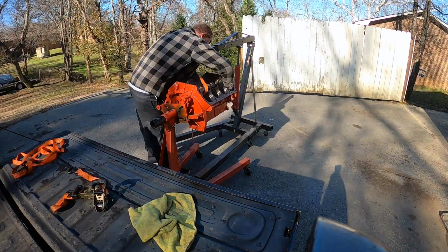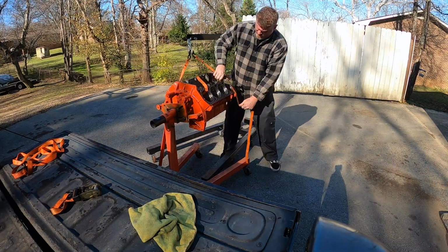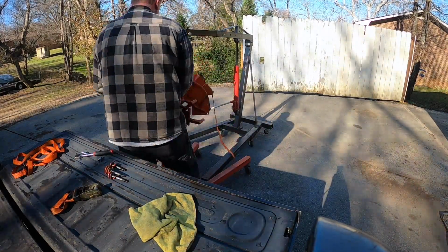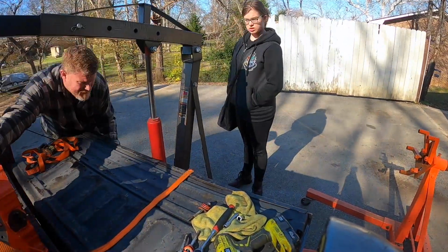Tommy's is going to go check it out. They're going to put their gauges on it and make sure that everything's running smooth. You definitely don't want a tight camshaft. That's a quick way to wipe everything out. So all that being said, we're making sure that the Howards cam is happy inside the block before I put it all back together again.